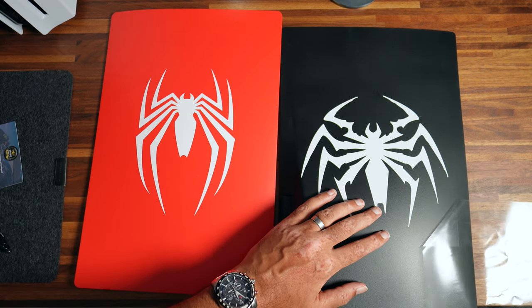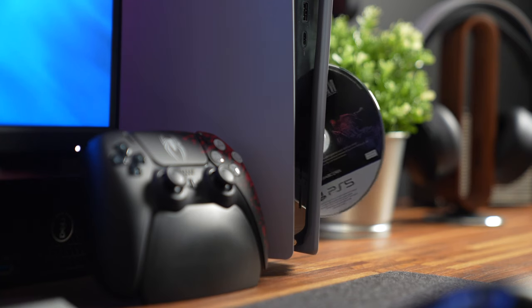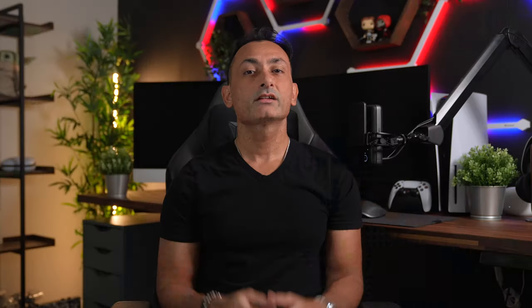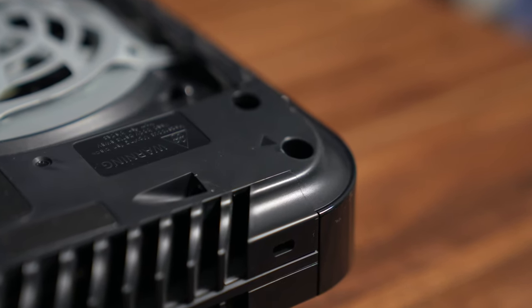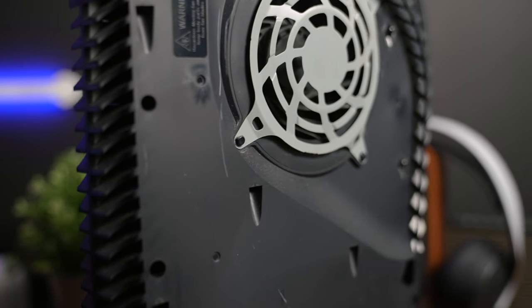Now that we have the vinyl stickers on the plates we have to replace the white face plates from the console with these new ones. First I'll remove any game disc from the disc drive, power off my PS5, and unplug the power, HDMI and Ethernet cables. The first time you try to take off the face plates it can be a little hard and tricky but after you do it once you'll understand how it works. The easiest way is to lift up the top back corner, raising these little round pegs that lock the plates into place — once the pegs are released you just simply slide the plates downward. I scratched my console from trying to remove the plates for the very first time; I used too much force, but it's okay because no one sees this anyway.